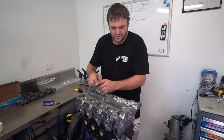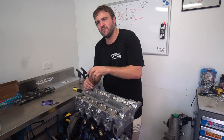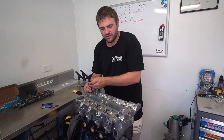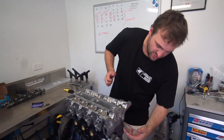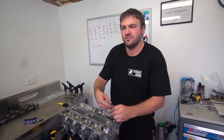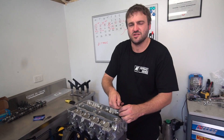It just helps a metal gasket seal because you're relying on the coating they give you, and sometimes it's just not enough. The machining on the deck face and block face is smooth enough to run the gasket on dry, no problem. But it's extra insurance — you've got an oil feed and oil drains all through the head. If one of those was to leak, you've got a constant leak. A bit of Hylamar fills that little nick that might be there.